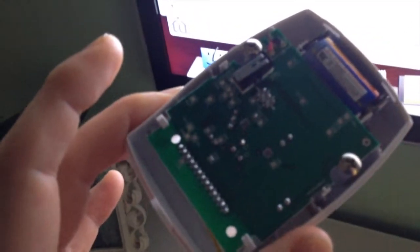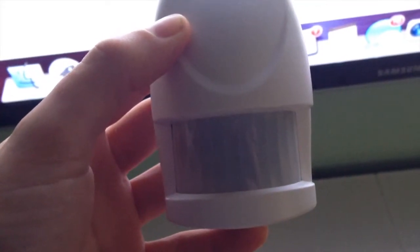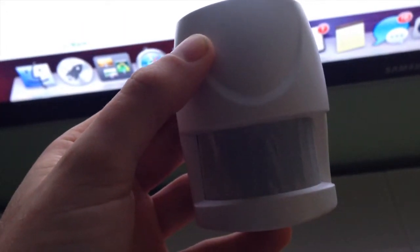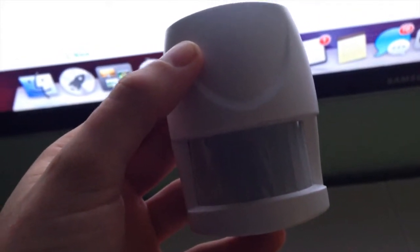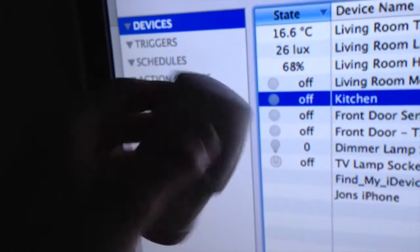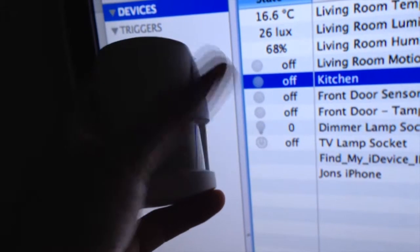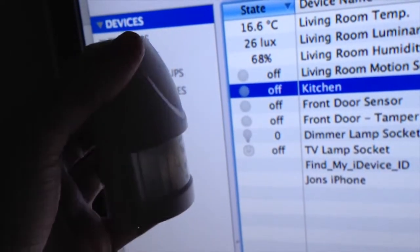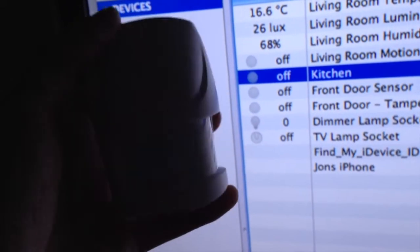Now I'm putting the back of the device on, which puts it in regular mode. It's flashing green to indicate it's in awake mode for 30 seconds, and now it's in normal mode. No matter what I do to try and activate the sensor, it doesn't activate — it just stays off. There's no LED indication on the light and no waking of the device.